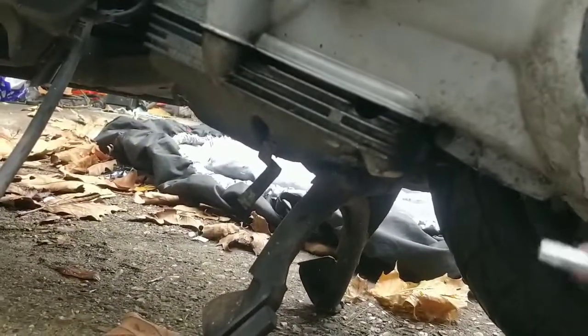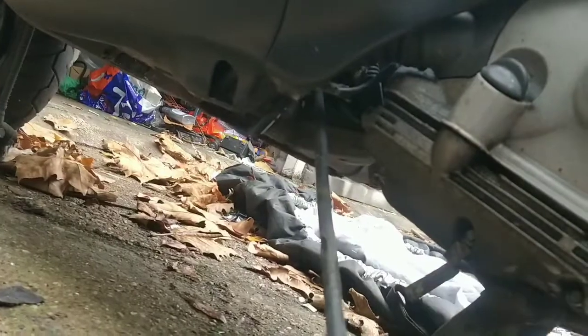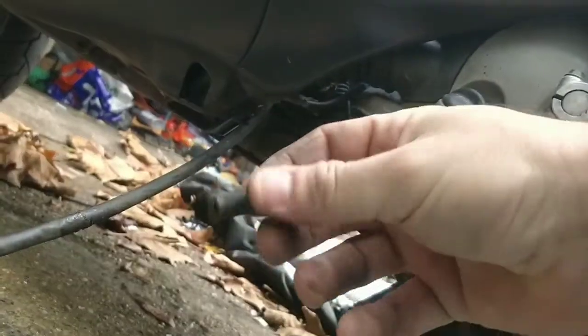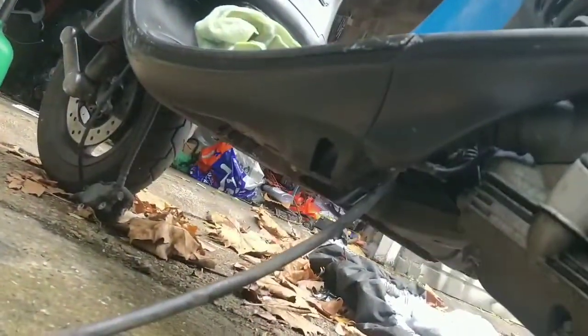So everyone, when you take away the brake line, you have to take it fully away. So it's attached here and here as well onto the engine. They're 8mm bolts, you pull them out. And then there's an Allen key bolt under here. You have to get it completely away from the engine like that. Also, put the adjuster cap back on so that when you're ready to swap back over, it all works.